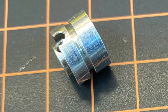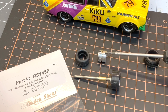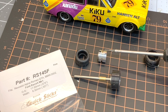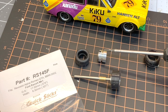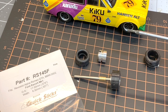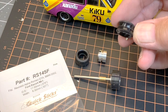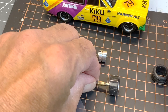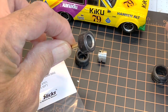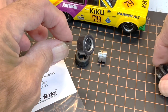It's different than most wheels in our hobby — we don't have a raised center rib; we have a reversed groove here, a very very narrow groove. You do have to have a little bit of tire to fit in there to keep it from going side to side. I'd still recommend gluing, though there's not really a whole lot to work with. Quick Slicks made a really nice mold — they've got the groove molded in place inside the tire. It's kind of hard to see, I'll take a photo, but it does have the groove, fits in there, and fits the wheel very very cleanly.